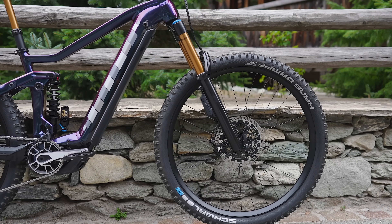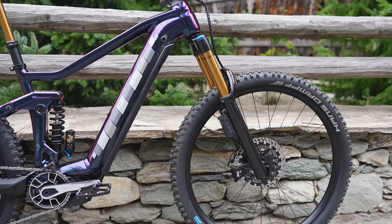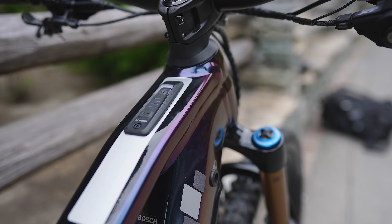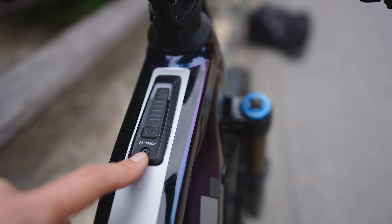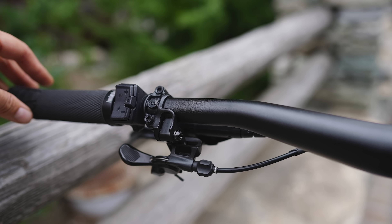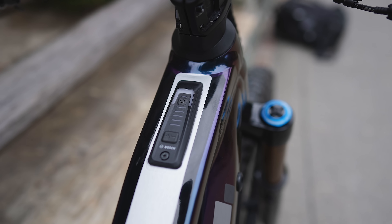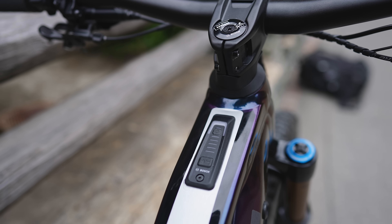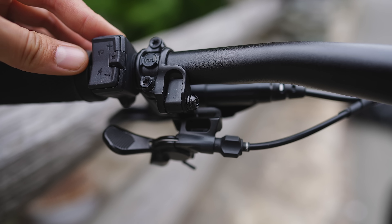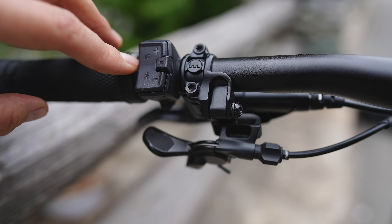You might notice on the front we've actually got ABS braking — I'll turn it around in a moment to check that out fully. But one of the biggest things on the new 2023 Bosch kit is this new smart controller, which is essentially the brains of the system. The existing Bosch stuff has the big chunky remote with all the smart features, Bluetooth, and connectivity built in. But this has all now changed — it's much more discreet. You can now run this mini remote, which is much smaller and neater. It's completely Bluetooth, so it's totally wireless.